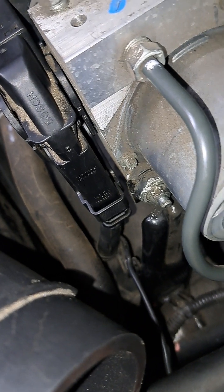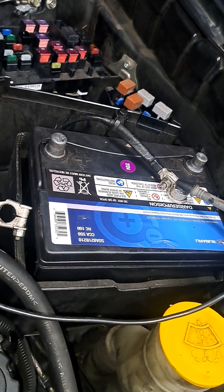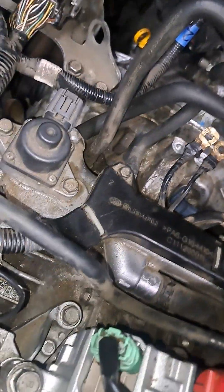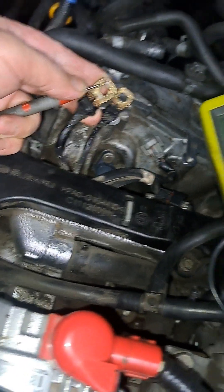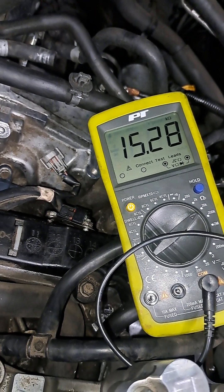This ground here was the one connected down there. This wire goes directly to the braking unit, and remember there's no voltage applied — it's as if the battery is not even here. So I touch this one: 5.70. Jump to this one: 1.40. Jump to this one: 15.27.